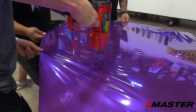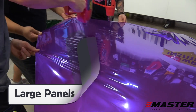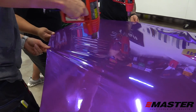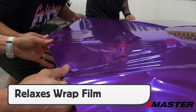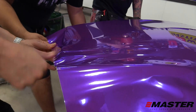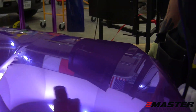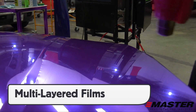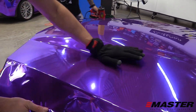For large sections where the wrap film has to be heated, the ProHeat STC can be adjusted for a high fan output. This will help heat the wrap film quickly so it can be conformed in a timely manner. For normal install usage, seeing the wrinkles of the wrap film relax indicates that the film can conform to the application surface. Taking the time to thoroughly heat the wrap film, especially for multi-layered wrap films like chrome, can help lower install times and ensure quality, especially on recessed areas.